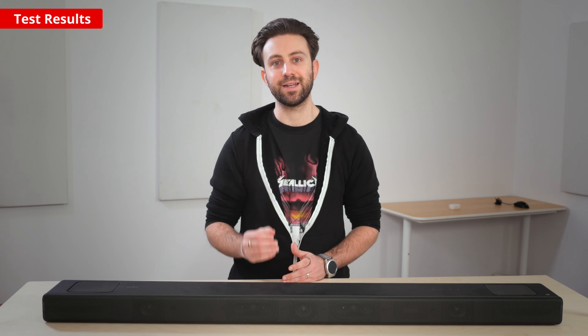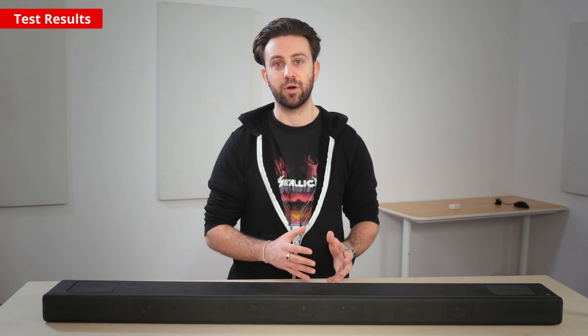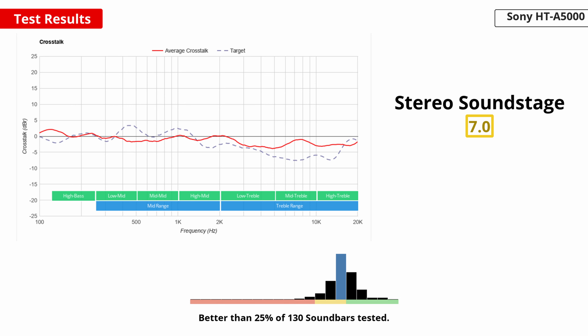Other sound enhancement features include Sony's sound field mode. When you turn it on, the bar's surround and Atmos drivers are activated. A good soundstage is important since the human ear recognizes spatial cues when listening to audio — for an immersive sound, the bar needs to sound like properly placed studio speakers. Its soundstage performance is decent. Like many soundbars, it uses psychoacoustic tricks to make it seem like sound is coming from an area wider than the bar itself. Sony calls it S-Force Pro Front Surround, and it works alright, but it doesn't have good focus — instruments in an orchestra, for example, seem to come from a more general area rather than a pinpoint location. It's also important to note that the bar's soundstage changes noticeably when you turn sound field off; without its surround and Atmos drivers activated, the soundstage is much narrower, though the focus is a little better.